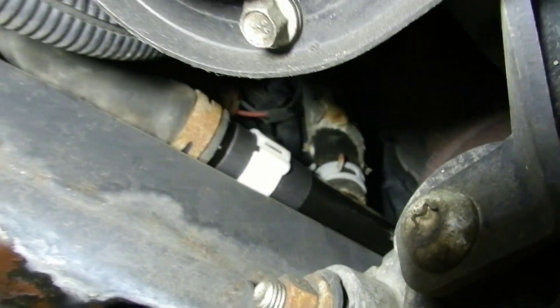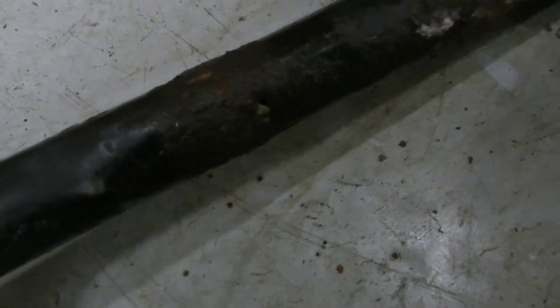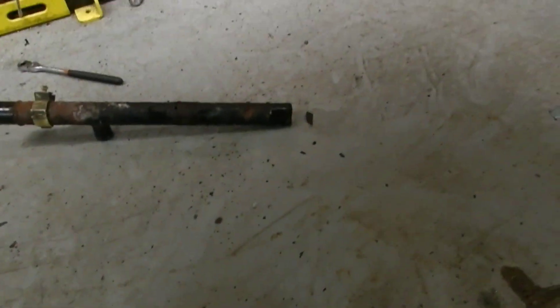Here is the coolant pipe — I'll show you how rusty this thing is. You can see the hole in it right there. That's where one of those clamps goes, and the water sits there with salt and whatever else from the roads and it corrodes the hell out of this thing. There's that pipe, just rotted like no other. I dented the end pretty bad and created a second hole — shine the light in there and you can see the two holes pretty easily. Was one hole but now it's two. This thing is pretty ugly underneath.